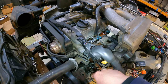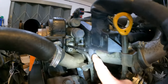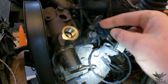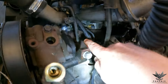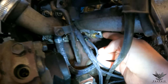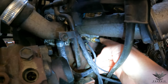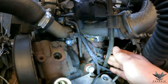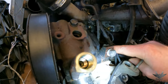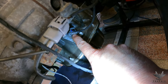We're going to start by going down, then that way, then over the top. The plastic comes down, breaks out, and the harness comes out there. Going down a bit, it breaks out to your coolant temp sensor. Bear in mind, you shouldn't see that coolant temp sensor — that's a JZX100 coolant temp sensor we fit when doing aftermarket ECUs for 2JZ into IS200, to get a coolant temp for our analog MPX device. So if you don't have that, that's totally normal. Also breaking out here coming down is your oil level plug.